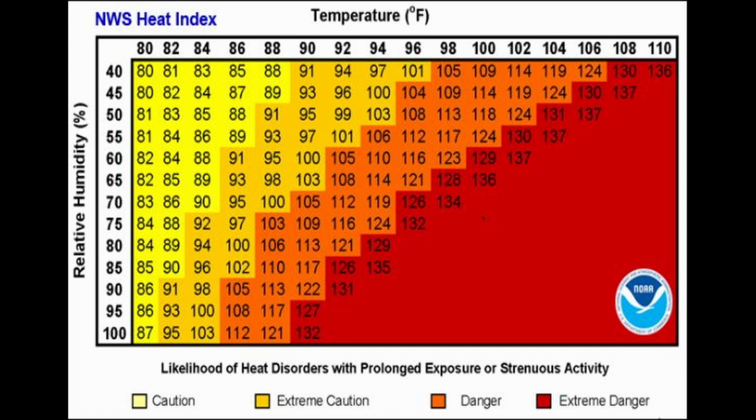Add to this the fact that the sweat is dropping from your forehead and from your arms. The sweat is coming out from your gloves. And if a drop of sweat lands in the finish, you can spray 20 coats on top of that and you will not eliminate that drop. You have to strip it back down. One drop of sweat ruins your finish. And if you bump your arm against the seat, you will see that spot forever and ever, unless you clean it all the way back down and start again.